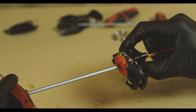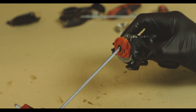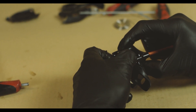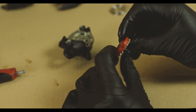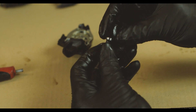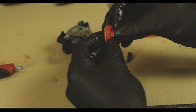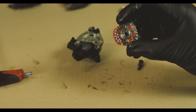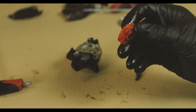We can see the spool starting to come off — that's all good. We've got the pivot bolt here and that bearing came out, but we can just slide that off the pivot bolt and pop it back into the spool, no problem. Set this aside if you ever want to go back and make your shifter 11-speed again, but this whole unit is going to be removed.